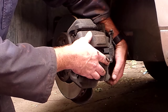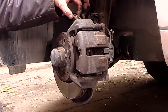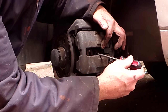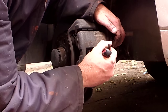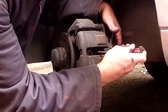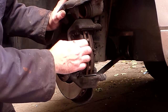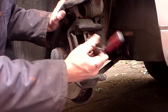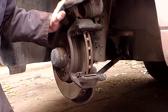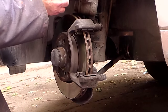If you've got a slight ridge on your brake rotor, you might not be able to get the caliper off. Take a screwdriver, put it in between the old pad and the piston, push a tiny little bit, and slide it out. Just push the piston back a bit into its bore to allow it to slide off. Old pads here — pop those off. They are pretty gone. It's amazing that you can negotiate like four hundred dollars off the price of a car for a fifty-dollar set of pads.